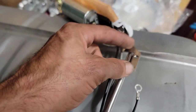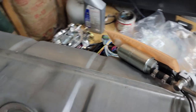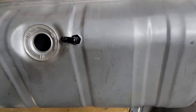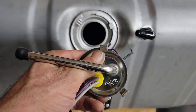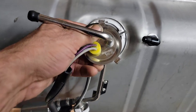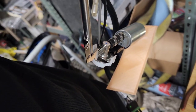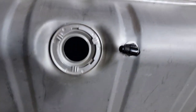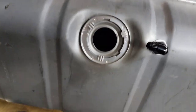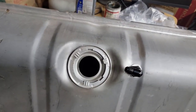The fuel pump was a little different for these — you do have to pull off the sending unit for a minute to put on the sock filter. Don't forget the sock — like wearing your shoes with no socks, your feet are going to stink. This goes in the hole. I wish I had a spare set of hands so you guys could actually watch me do this. But remember — this thing has certain prongs: one at the tip goes straight up to the top one, and this prong goes to the bottom-right one. That ring holds it all in place. Put your fuel sending unit on this piece with two screws. This is for the Impalas — other models may vary.